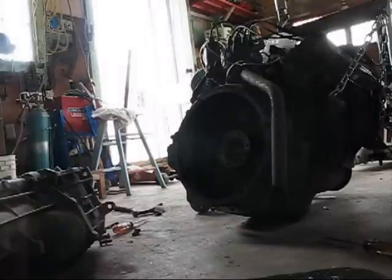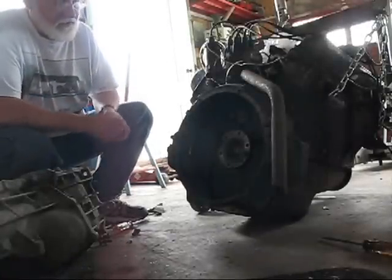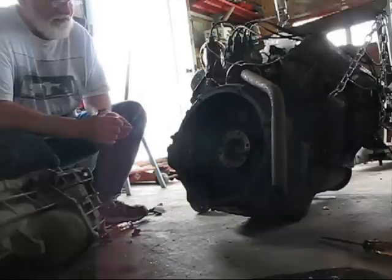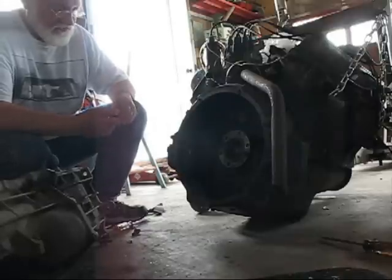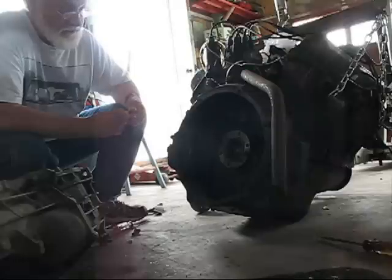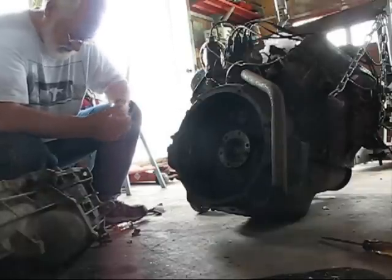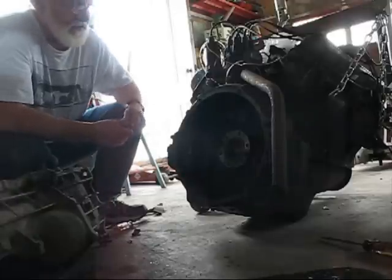Here's a little bit more of an update. I've talked to Pat, who built my flywheel, about this. Apparently I've got a kind of an unusual crankshaft — it looks a lot like a later model Cadillac, like a '55, '56, '57, something like that. I went on his website and studied the photos. Pat's kind of an expert on this stuff, and he said that basically if it had been the original crankshaft this would have fit. It could be that somebody put a later model crankshaft in the engine at some point when they were rebuilding it. Anyway, I got a hold of him and he's going to make me a piece to fit. I've been out here with calipers taking all kinds of measurements to make sure it's all going to fit, and I sent off to him what I need and he's going to work on it and get it all put together.